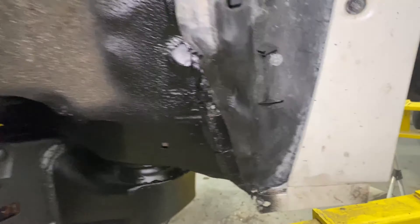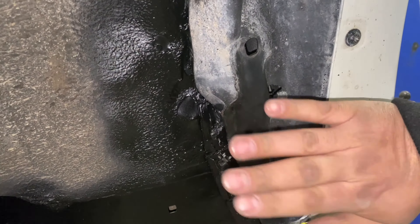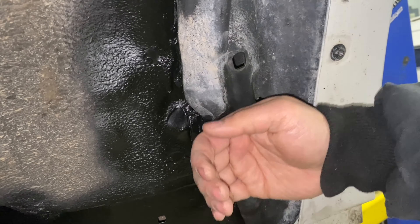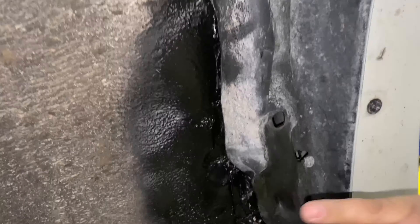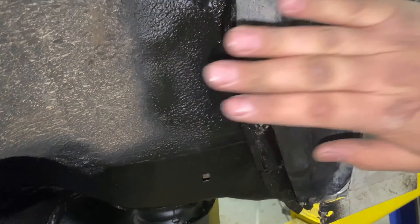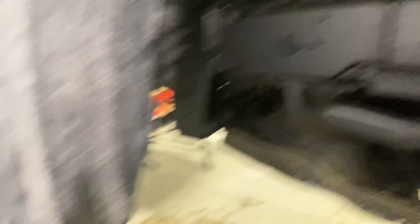I just pushed it in with a sledgehammer while holding it, then gave it some heat. Over here you can kind of see some of the body seam folded downward. Before it was sticking out, and what I did is I cut ribs into it, then slowly hammered it in and covered it with some undercoating. I still haven't trimmed this side yet, but we'll work on that here in a bit.